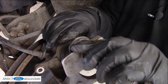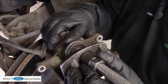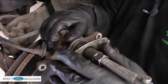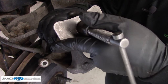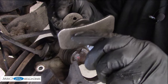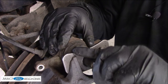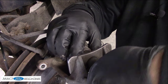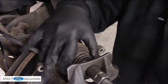I have the caliper right here. You take the tool and slide that bracket right back here against the stop of the caliper. You have to back it off a bit to get it set — I had it backwards, let me slide it around. There we go — got it in here with the tabs set up, so now I can start putting force by screwing it backwards. Clockwise or counterclockwise, depending on what you've got.